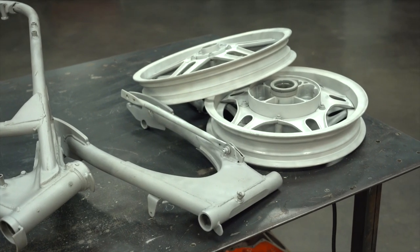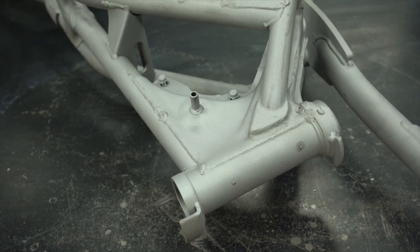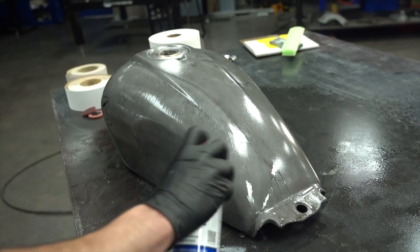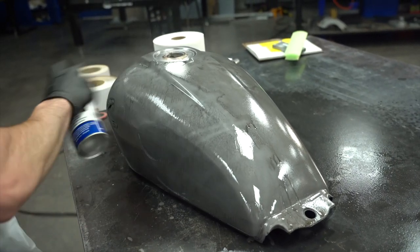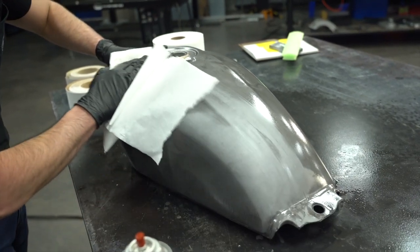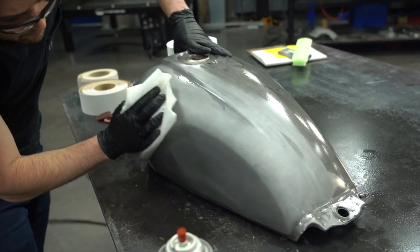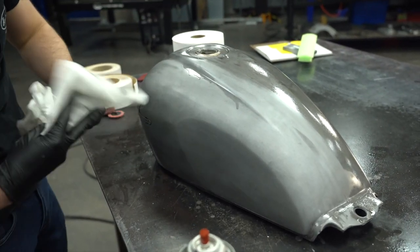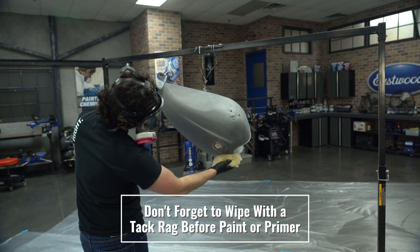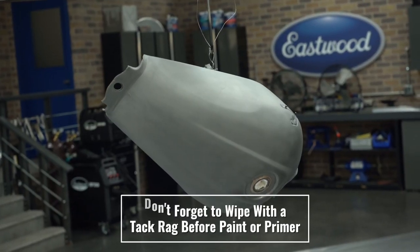We're all done blasting. Got everything cleaned up — most of that stuff is going to stay in storage inside for a while until we get to it. But we wanted to get to the main part of today's project, which was getting this tank and cowl into primer and then filler. When it comes to prep work: when you're done blasting, you're going to be left with dirt and all the glass media on your parts. You want to make sure you get that as cleaned up as possible. We just used some pre-painting prep — you can use acetone, whatever you need to do to get that bare metal as clean as possible. So at this point our tank is clean and looking good, and we cleaned up our cowl off camera too. Now we need to get into primer.